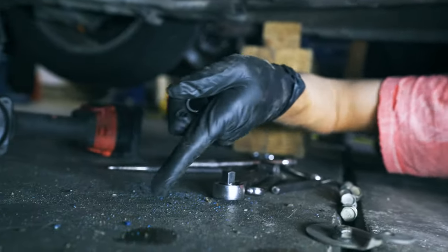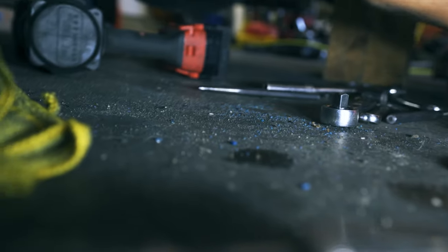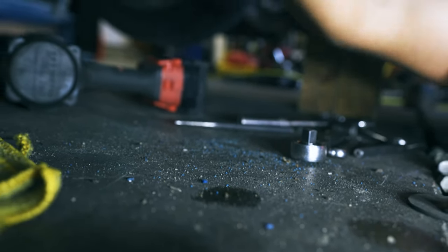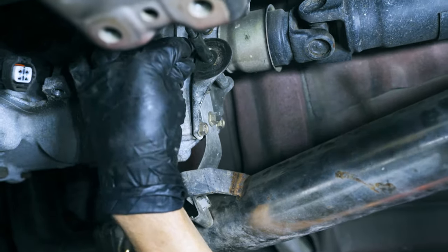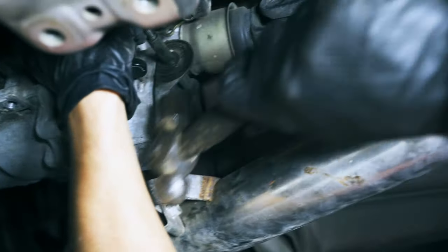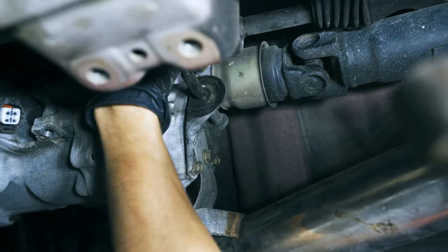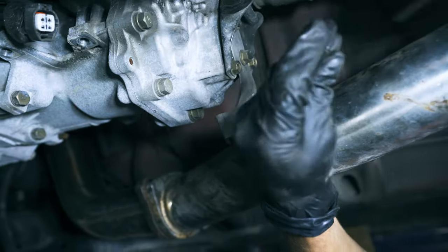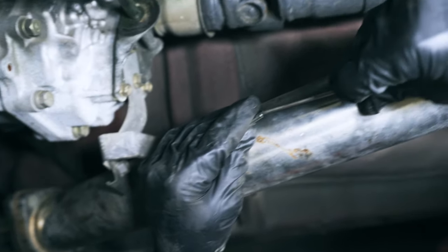Dude, look at the floor — holy crap, what are those blue bits? That's all the bushing disintegrating. Holy crap, it's disintegrating as we're working on it. So I found a coil-over adjuster — I'm going to try to stick it in here just to hit the edge of it, because that pick tool got major stuck and took like a good solid 10 minutes to get it back out. Just like that — that was easy. There's the inside pin. I was just getting it on the very end, and then the second one will take quite a bit less effort. Longer extension did the trick.